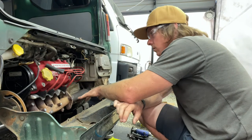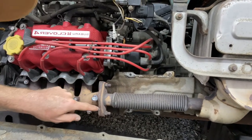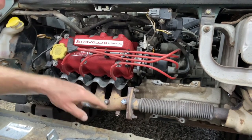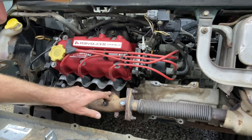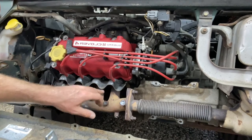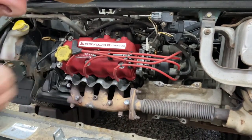Okay, we got all this off. Now we're going to need to remove these two bolts here, because I'm doing an exhaust. I was basically showing you — if you need to do a heat shield or something with your exhaust. This is actually a shield and a gasket, so if this is bad, this whole piece gets replaced if you're leaking on your exhaust manifold. I was just showing you techniques of how to get the manifold off when it's super rusted, which it most likely will be.